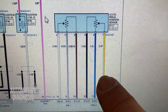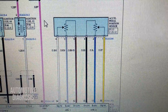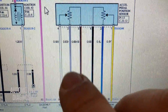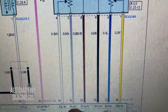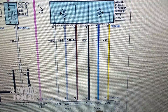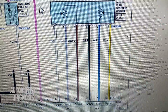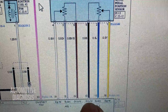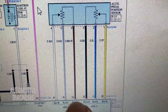As you see on the wiring diagram, there is only one connector on the accelerator pedal position sensor. We have three wires for APS1 and three wires for APS2. For each one we have the power supply providing five volts — some cars provide one supply for both, but some manufacturers separate the supply for safety. We also have a ground for APS1, a ground for APS2, and a signal wire for each one. So generally three pins per sensor, two sensors — six wires total.